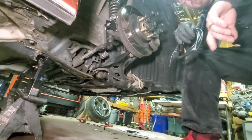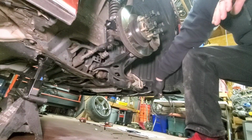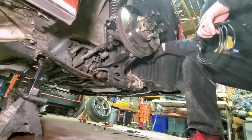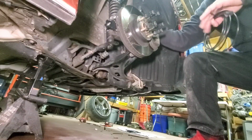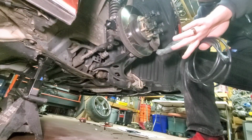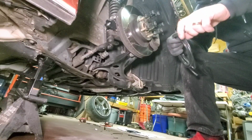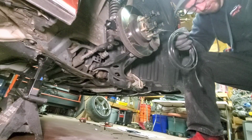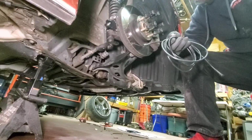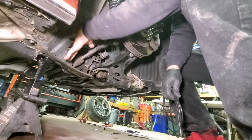Alright guys, so we're going to put the extensions on, making the extension cables right here. We're going to connect from here to the next one. We're going to route it through behind the fender well here, behind all the shock tower, all the moving parts. You want to make sure you keep everything away from moving parts. It's very important that you do so, or you're going to find out that this stuff is going to get wrapped up in there and they're going to stop working. So make sure you keep it tight up against the body. Keep it away from moving equipment.